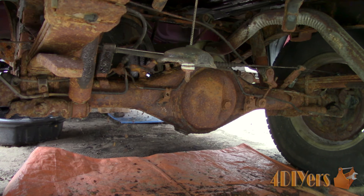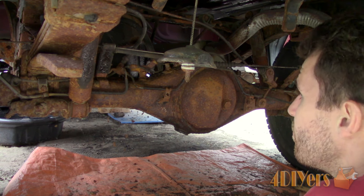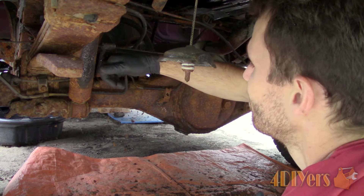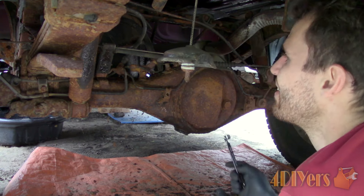This is one of the many methods for dealing with broken bolts. You can also weld the nut on, drill the center and use an extractor, or grab the remaining stud from the backside using allen or locking pliers, etc.